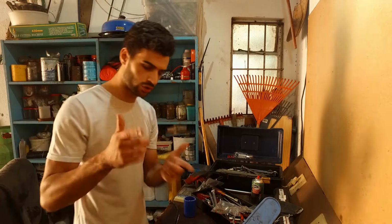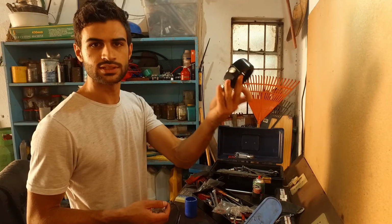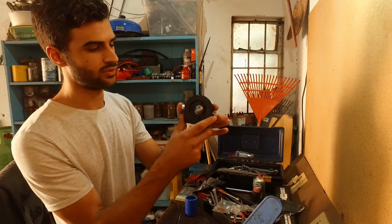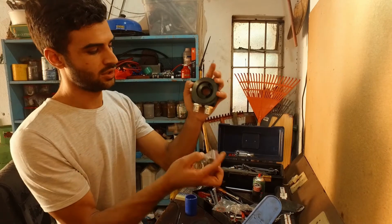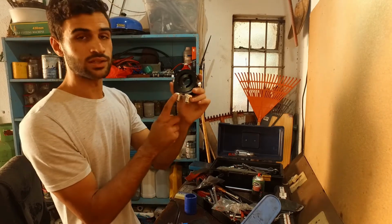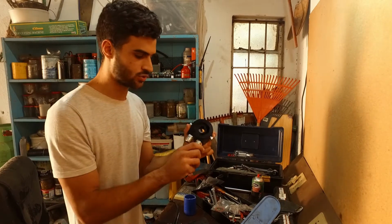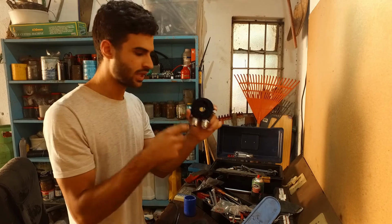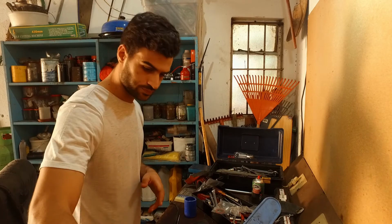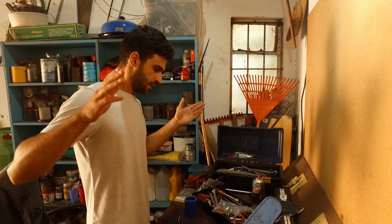So we went past Corian yesterday and we picked up, anyone know what this is? This is the oil filter sandwich plate, right? Where the current oil filter is, we'll screw that out, put this on here, put one of these guys through there, bolt it down, and then put the oil filter on this side. This one is specifically made so that we can run an oil cooler, which we aren't going to do right now. So we're just going to loop that back, and on the sides here we can run our oil pressure and oil temp off that. The reason I printed these yesterday is so we can get those installed with all of that.